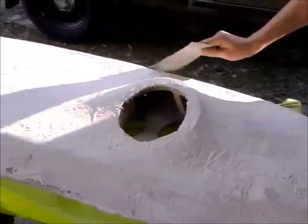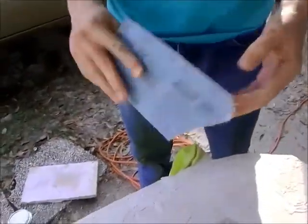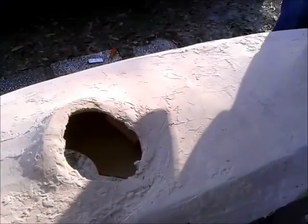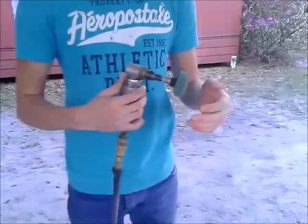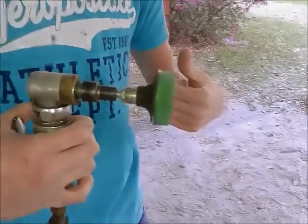We're about halfway done sanding and RJ literally used the sandpaper until it fell off, so we're trying to get the most we can. We're going to use undercoating — it's like a rubber textured stuff — so we're probably not going to sand it until perfectly smooth. Just sand down the high spots. We had so much sanding to do that we had to switch to a pneumatic sander.